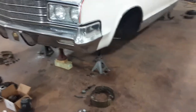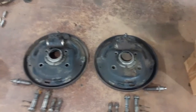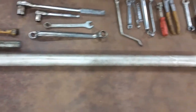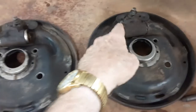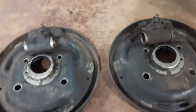Where we're at now, I've got the parts just about ready to come in for the brakes. I had to take the backing plate off, which was a bit of an ordeal. I've got those right here — they're basically the same except for which side is plugged at the bottom for the star wheel to turn. These bolts were hard to get off; I had to use about a four-foot long breaker bar to get them out. I had to remove the backing plates because one of the two bolts holding the wheel cylinder was not accessible with a wrench.